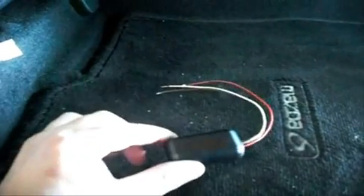Here under the seat, in the front part, there will be these plug-ins. I've already taken them apart — they're usually situated right here. This wire goes underneath the seat to the sensor mat. You can see on the plug-in there are color codes on the wiring, similar to the codes on our simulator: white, red, and brown.